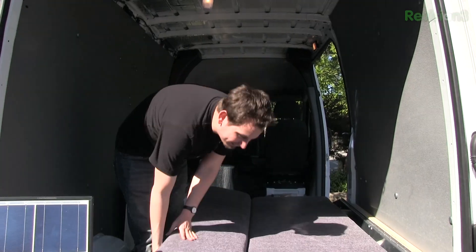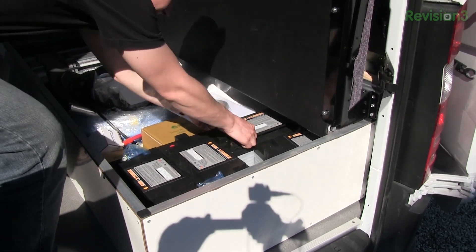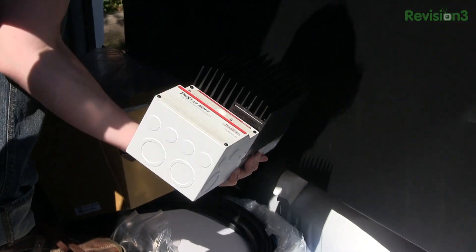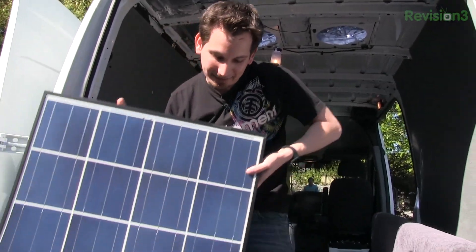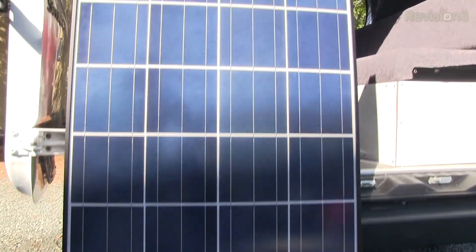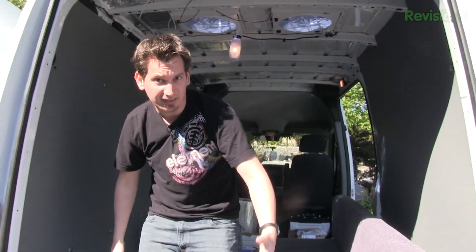Check this out. I'm mounted inside this new awesome box we built. You can see we've got four massive AGMs here and a pretty ridiculous charge controller. This is all going to be tied into a system that's coming — roof racks are on the way. We're going to put this into the roof and basically get three of these massive panels. It's 130 watts each, so I'm going to have tons of battery bank and tons of ability to soak up some rays from the sun. And then hopefully there's nothing I really need to do as far as AC is concerned.